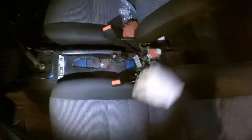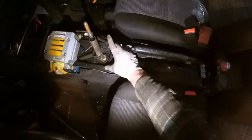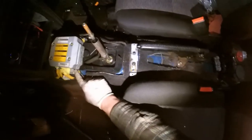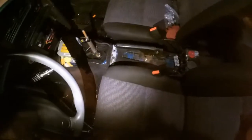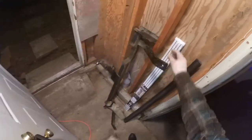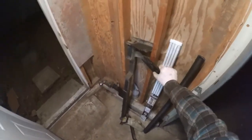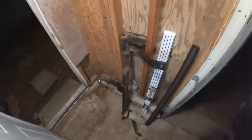I think I have to do all the brake lines. You can see the e-brake cables are reattached right here. I need to find some 6mm or 8mm bolts to go in these holes to secure the boot around the transmission tunnel. There are a couple underneath the ABS computer that I probably can't get to because they have crazy star bolts I don't want to mess with. As for the trailer hitch, I can bolt it in except for these bolts right here — there are marks on the chassis but no holes, so I have to drill holes and put a nut through the other side. I also need to figure out the brake light wiring for the trailer.